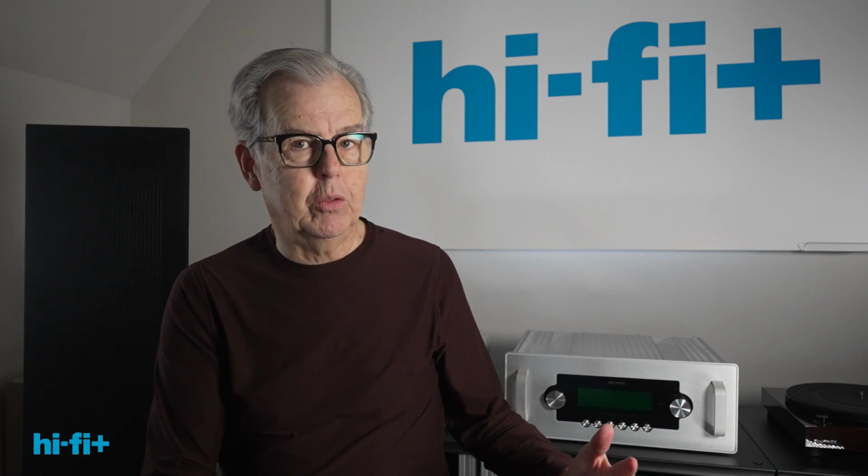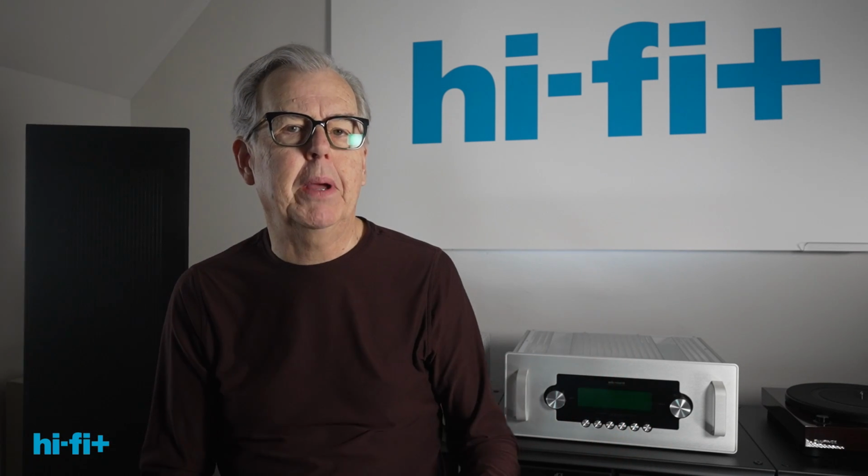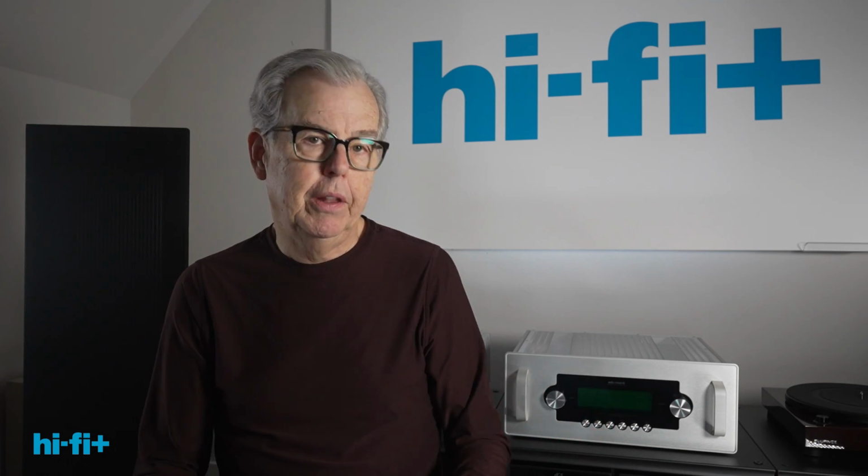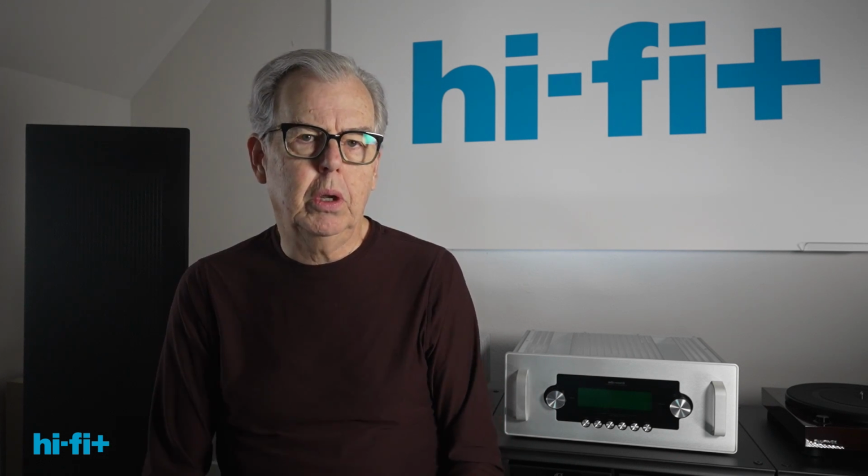As I said, we listened with electrostatics, which I think Magnepan's idea was that's about the hardest test we can throw at this thing. So it ought to impress you that we've built a really good woofer if we can make it integrate with electrostats. So that was cool. And of course, you could also use it with Magnepans because magnetoplanars, like electrostatics, are dipoles and they have a natural bass roll-off. That means you would probably like to augment or fine-tune the bass in some way.